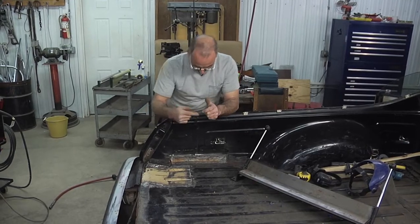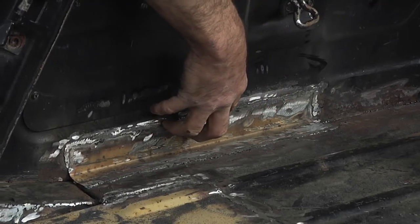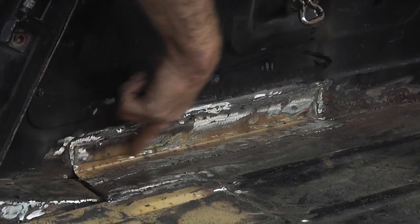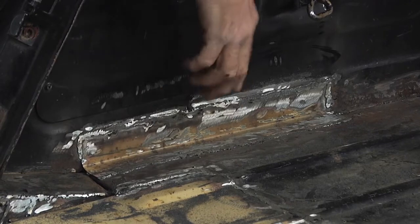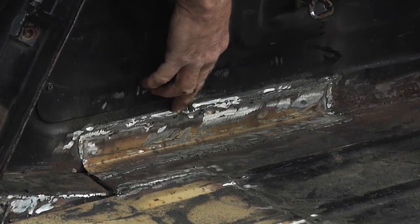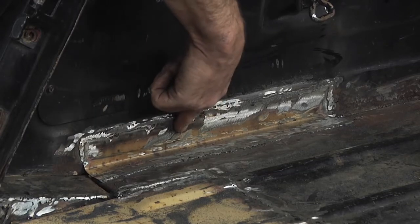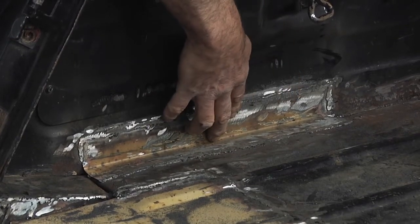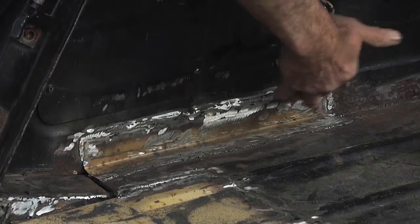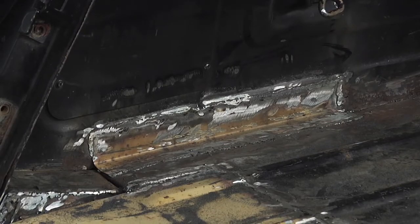The one on the side of the box is a different approach. There were a couple of small holes through the box, and it was very easy to take a piece of sheet metal from our donor vehicle, then using a brake put that 90-degree angle into it, weld it up against the side of the box, and weld it to the bottom of the box. This was so easy to fabricate — it would have been crazy to take the approach of cutting it out and scabbing in a new piece from the donor vehicle.